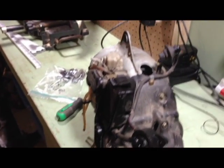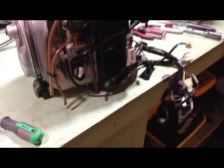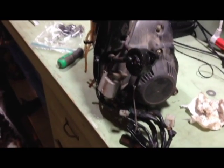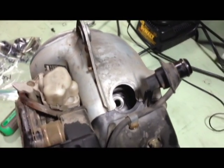I've gotten the motor out, now it's time to start the disassembly process and strip the components off so I can get down to the block and take a look. I've never worked on one of these before so it's been a learning experience, but I got it cheap so worst case I sell parts off of it and buy a new one. I was told it cranks over but doesn't catch. I don't have the adapter for my compression gauge, but I can feel compression when I put my finger over it and pull the cable — though it's not a lot.